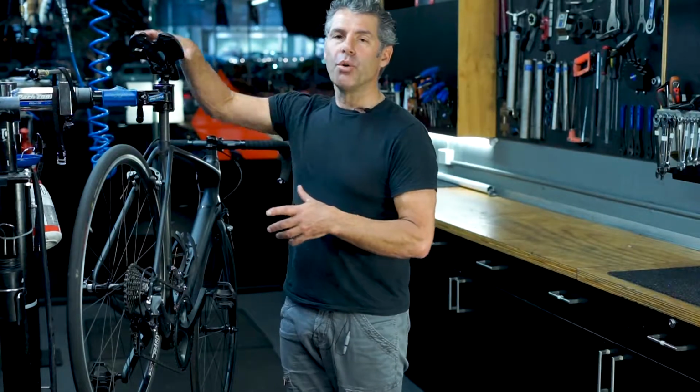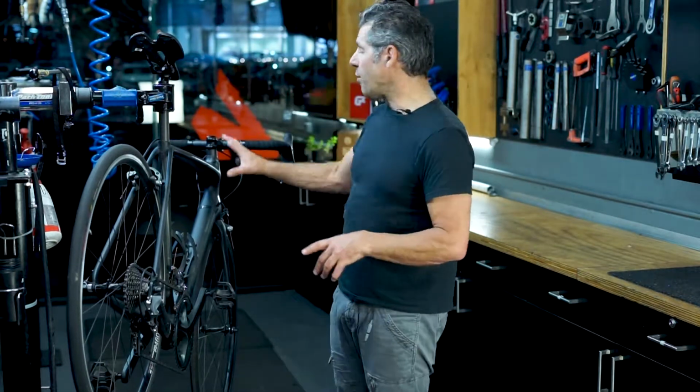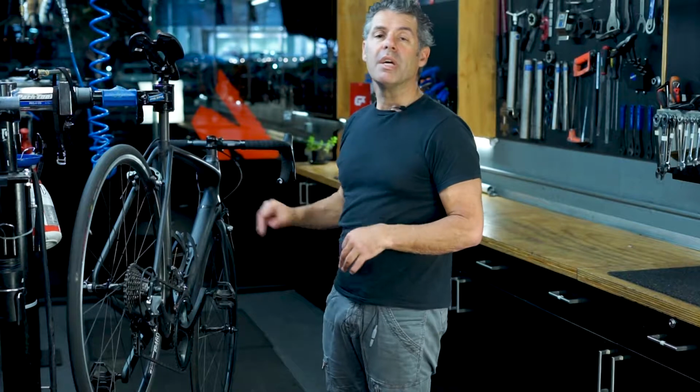If you would like to find other knocks and creaks in your bikes, you need to use a process of elimination. For example, if you stand up, noises from the saddle or the saddle pillar or the frame up the top end may go. If you put a lot of drive on the bike but hang on to the middle of the handlebar, then any creaks through the handlebars might go. So you've just got to keep using a process of elimination of finding out where that noise is.